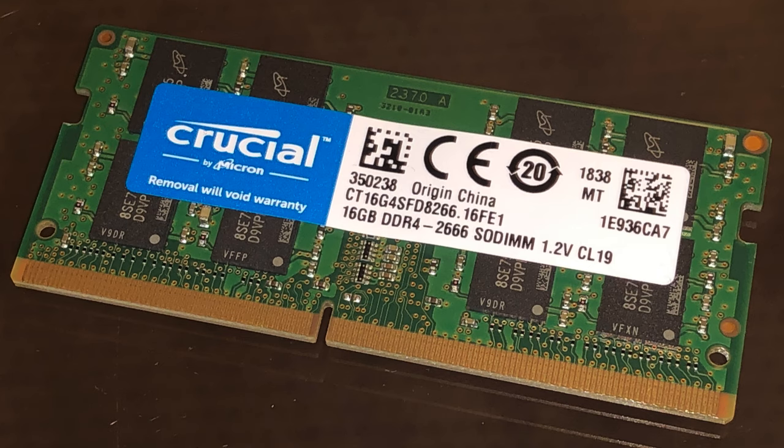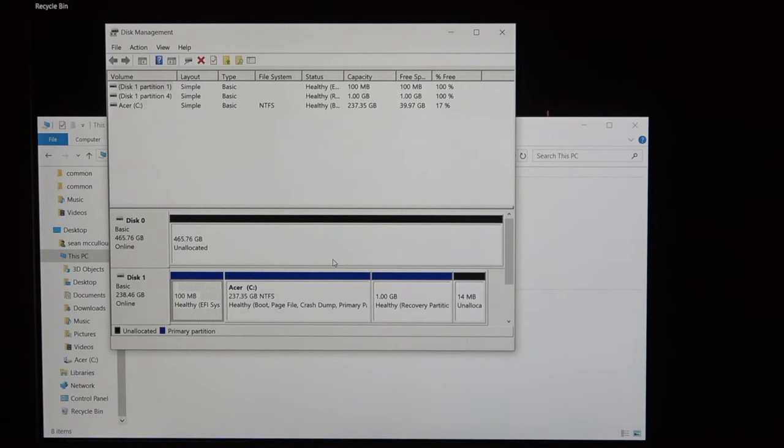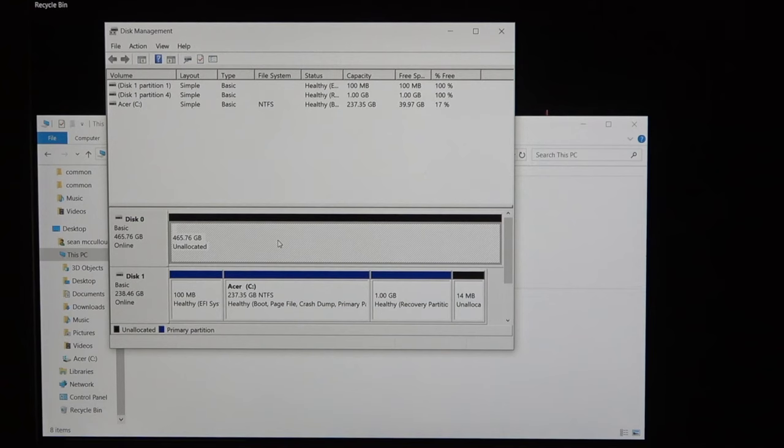That was a quick look at how to do some upgrades on the Asus GU501. I'll put a photo up on screen of the exact DIMM I used — all I did was Google 'Asus GU501 memory upgrade' and a Crucial link came up. They had a product page and I just clicked through to Amazon and bought it there. I'll put a link in the description for that too. When you first start your computer up after this, if it's a brand new hard drive, you're going to have to go into Windows Disk Management and do an initial format on the drive, and then Windows will recognize it no problem after that. I hope this was helpful. If you have any questions you can drop a comment, otherwise give this video a like and subscribe to the channel.